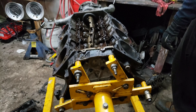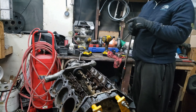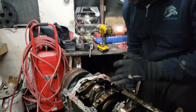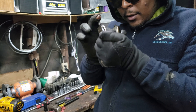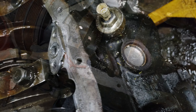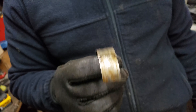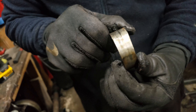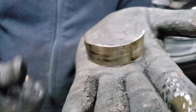Alright, I'm about to spin this thing around, then we can get the pistons and rods out. Alright, first rod is loose. This doesn't look too spun — it looks fucked up, feels fucked up. Yeah, you just got fucking gloves on. That's not happy — so that one's kind of spun a bit. Good call. This one's kind of scored. Yeah, that's your problem — it's fucked up. I definitely see it. These are those new tapered bearings.